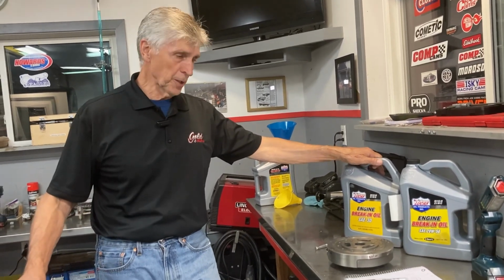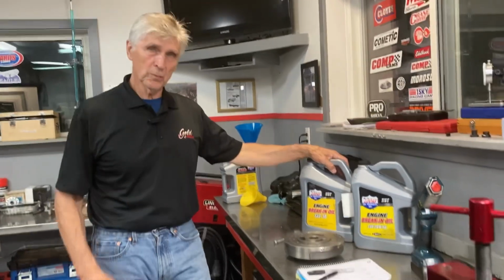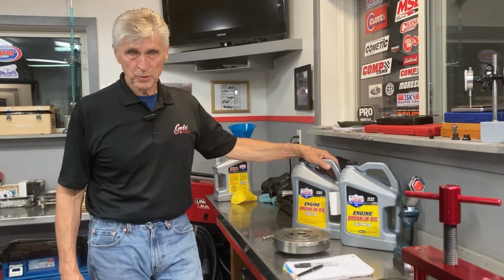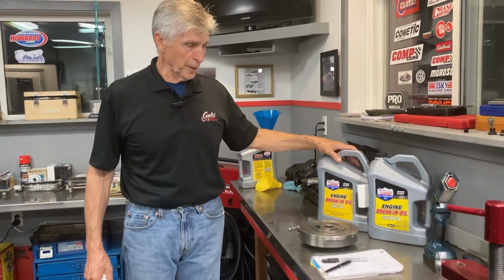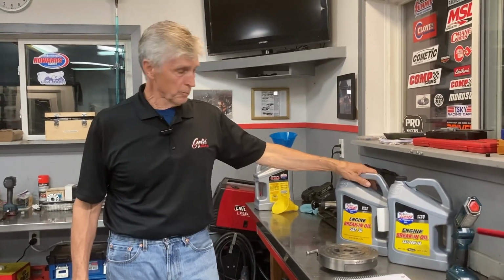It doesn't really hurt anything, but you do not need it. It does take a few horsepower away from you, and unless you've got something really crazy going on, running high RPM, whatever, you don't need it. So now we've actually got the problem of trying to take oil pressure out of this engine because it's got pretty good bearing clearances. So we're going to go to 30 weight oil, and on the next startup, we're expecting that the oil pressure will go down a little bit anyway.